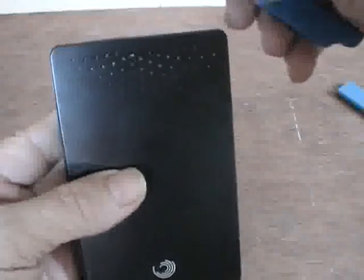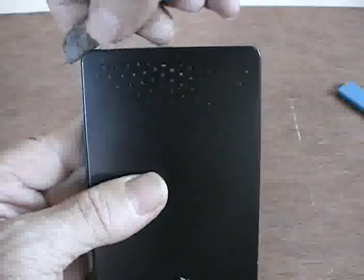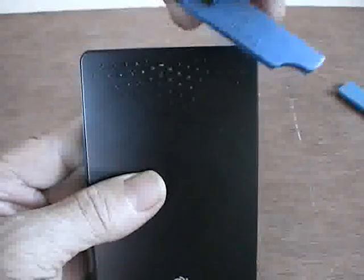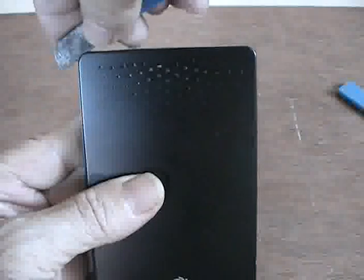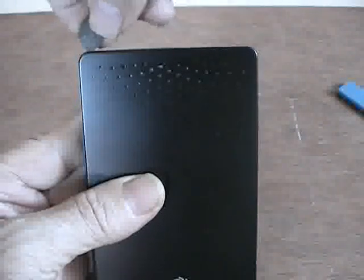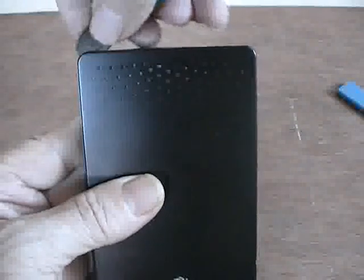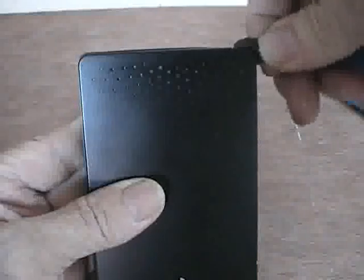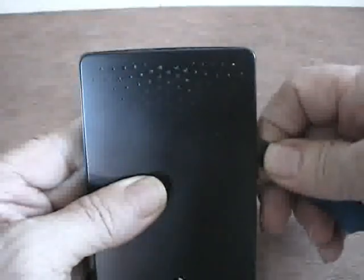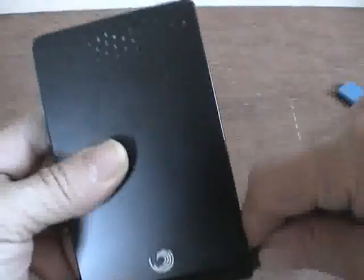In order to remove it, you find the seam at the very top edge of the case and you work your knife in carefully into that seam using a very small knife. This one is about the thickness of an exacto knife but a little bit safer to use. You take your edge and move it in, making sure that you are at the seam — the top of the seam between the case and the top of the case — and you move the knife slightly at an angle towards you as you go in. At that point you will be able to go up towards the lid and start to separate the lid, as I'm doing now.